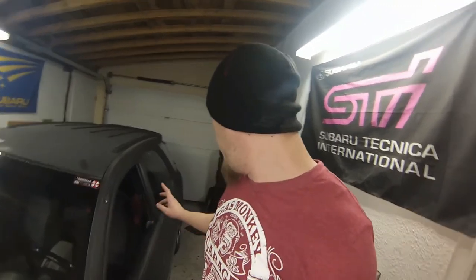The fronts are off that '99 Legacy Outback, but I have replaced the calipers and done all the new front brakes. So quite a bit larger rotor, and going from a single piston caliper that was originally on the car to a two piston caliper. And in the rear, which was originally drum, I've converted it to the single pot rear disc brake conversion, basically from the regular Imprezas and WRX from that '02, '03, '04 era.